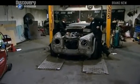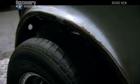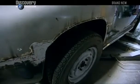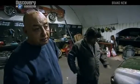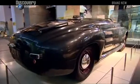Having solved one problem, another crisis rears its ugly head. The track of the wheels is too wide. They're protruding outside the arches. The Jaguar front beam and rear beam are obviously wider than the original chassis and front beam setup of the Rover. What we've got to try and do is compensate for everything, but make it safe, but also make it look right. Wheels beyond the arches aren't just illegal, they also don't match the Jet 1's sleek look.